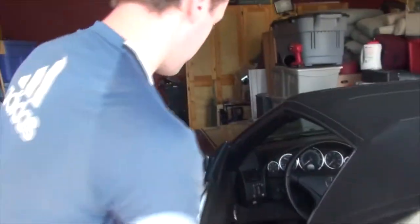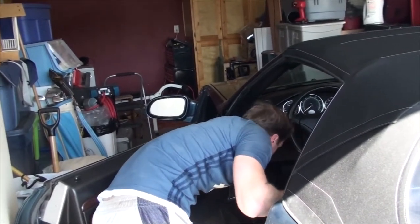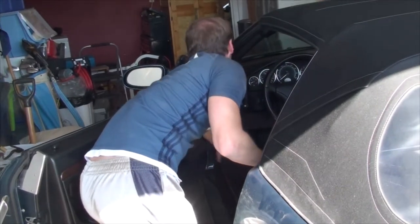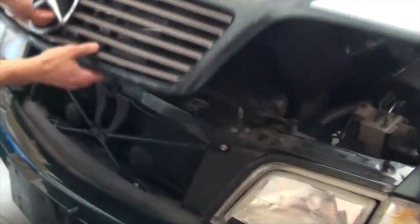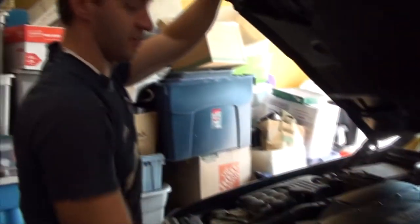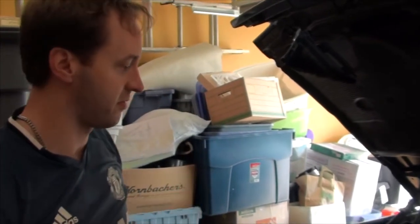Let's go ahead and pop the hood. There's a release latch right here. Feels like the trigger of a gun right next to the emergency brake. When you pull it, you'll hear a click. Front of the vehicle. Now follow me over here. And then underneath the emblem, there'll be a slide latch. Pull it toward you and lift up. Now this vehicle doesn't have an attachment arm. It'll just stand up by itself.